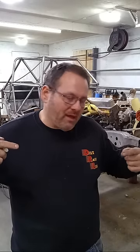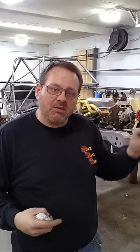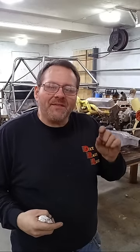In reality, when we run the instant centers across and we run the X across on the roll centers, we get this blended point. Well, it's actually a lie because it's an independent front suspension on the car. You actually have a set of curves for how this right front's acting and curves for how this left front is acting. And it creates this fictitious roll center point in the middle that doesn't actually represent the true roll center.